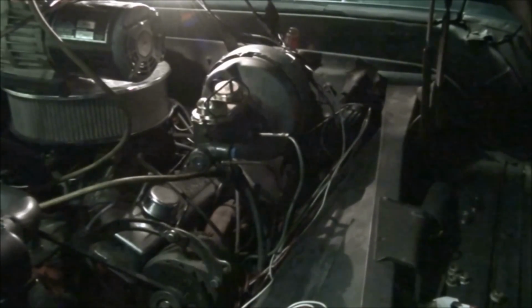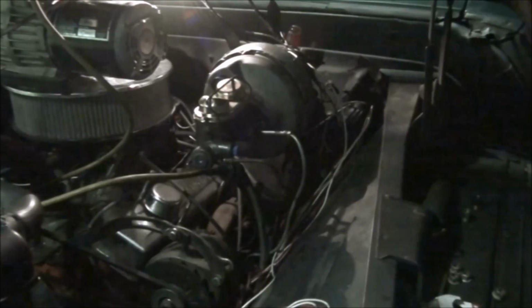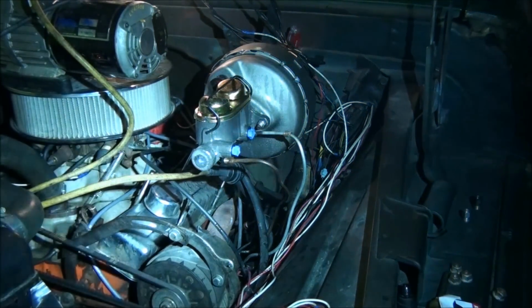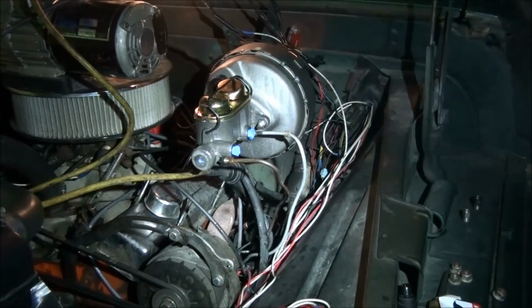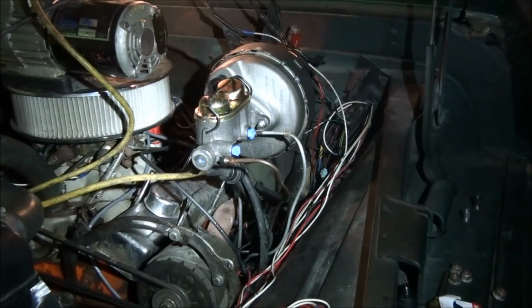Okay, for once, you get to hear me say this. I screwed up years ago. I got looking at this, and the more I looked at it, the more I looked at it. You see the old front line there, it's rusty looking, and the back one is all nice and new looking. Well, that back line goes to the back brakes, and the rusty looking line goes to the front brakes. This particular master cylinder does not plumb that way. And I actually went in the house and researched it on the computer and checked it out and went, okay, the tow wrecker's a dumbass.